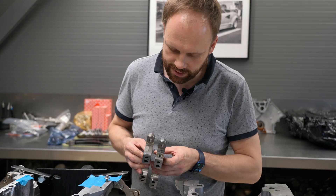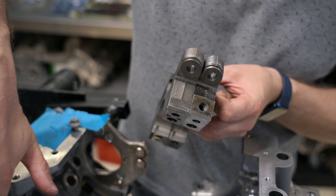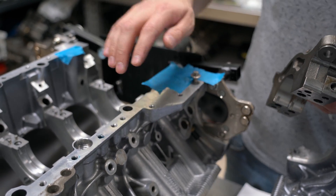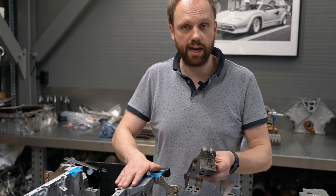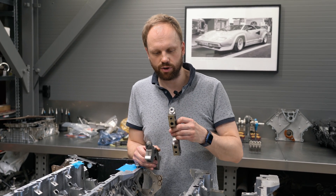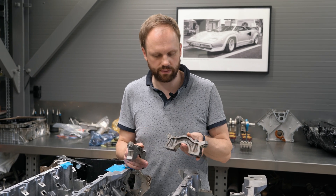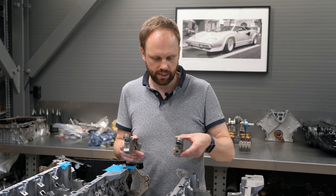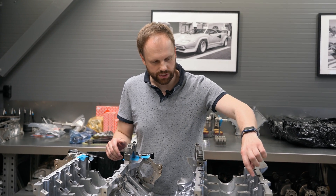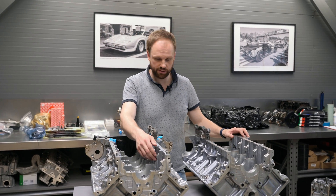On the N series there is no hole on the side of the block, but the castings are there — which means that when BMW planned this engine, they designed it knowing that with the S series they would put bolts there. With the S series introduction on the F90 M5, they started using different main caps with screws on the side. This difference is also why on the S series you have oil drain under an angle, while on the N series it's straight.